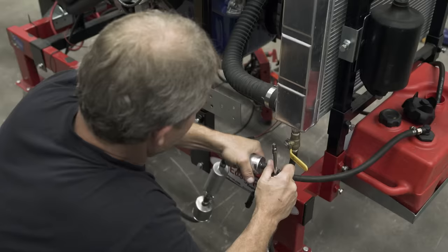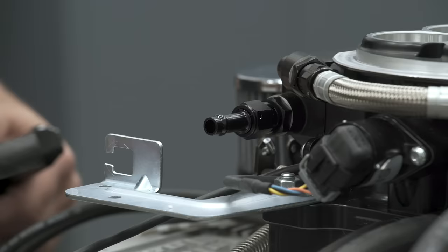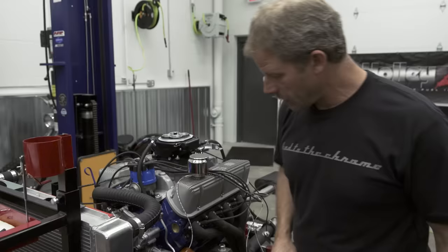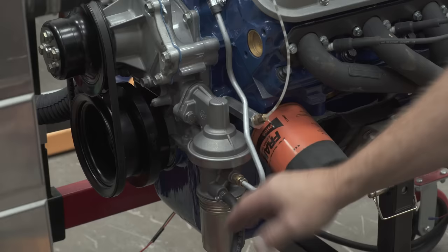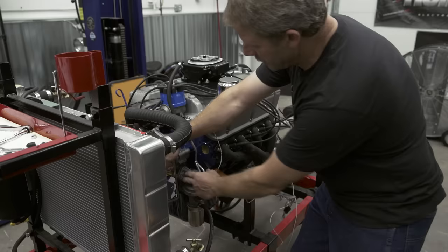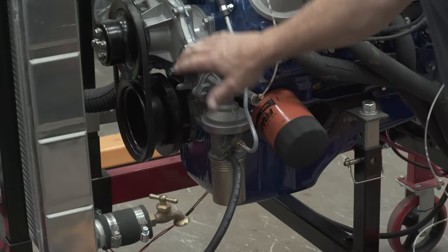You're displacing the electric pump into your fuel line with the filters. If your current fuel system does not have a return line, you will need to add one to your tank. Since the throttle body utilizes the electric fuel pump for higher pressure, the mechanical pump can go away. Remove its two bolts, completely remove it, eliminate the fuel lines to and from it, and then use a block-off plate to seal the oil from coming out of the timing cover. For our purposes, we're going to take our inlet hose and connect it to our outlet hose to completely bypass the mechanical pump.